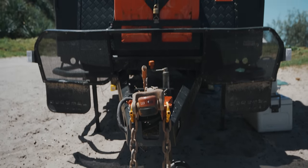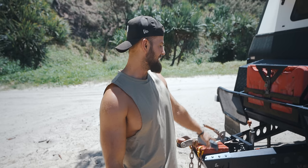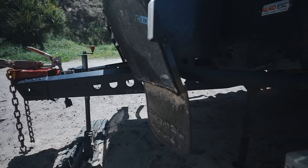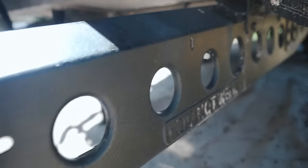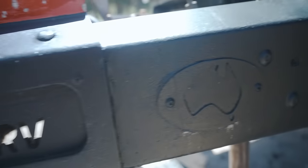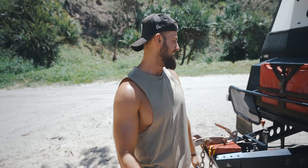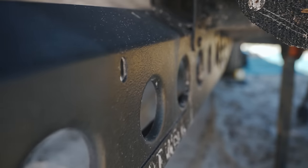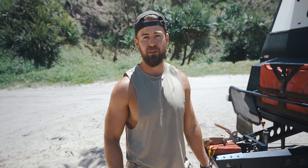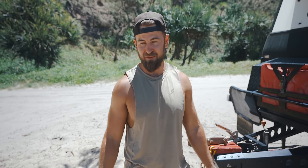Moving on to the all-important chassis — probably one of the most important things in a caravan, especially an off-road one. It's a six-inch thick FRV punched steel chassis, which is a lot better than the four-inch chassis you see in many vans nowadays. The punched holes in the steel run the whole way down the van to help reduce weight, which is important when towing — you can use that weight allowance for other things. The extra thickness helps with strength and not breaking on gnarly tracks.